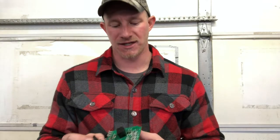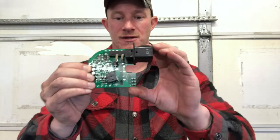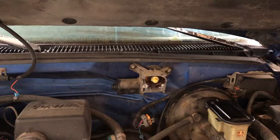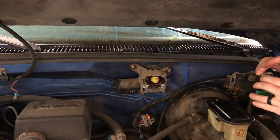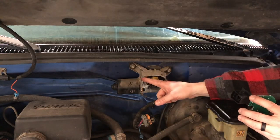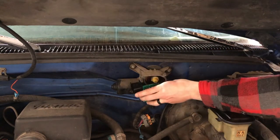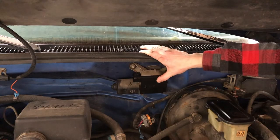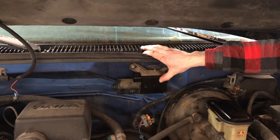So let's take the new one and install it in the pickup right now. Before I install it, I think I will put a little bit of dielectric grease on these three prongs — these are the ones that I told you to be careful of when you're originally pulling it out. Probably a little bit on these contact points up here, and just be careful that you don't break them or anything. Putting the new one in is the exact same as taking the old one out — you just want to be careful with it. There's kind of a channel there where this part slides into, so we'll just slide it right in, make sure that it's pushed in all the way, and then we'll put our new cover on. Some people put a little bit of silicone around this before they install it, but I'm not going to worry about that.